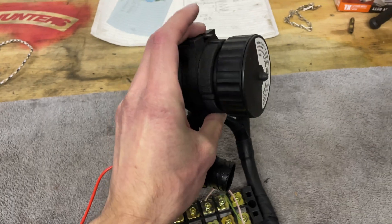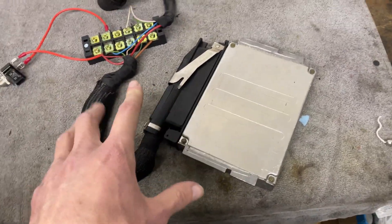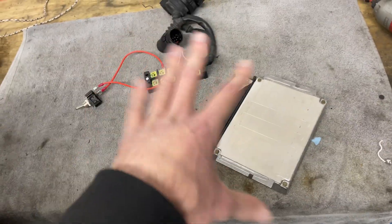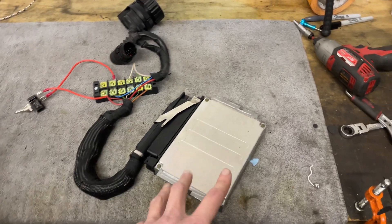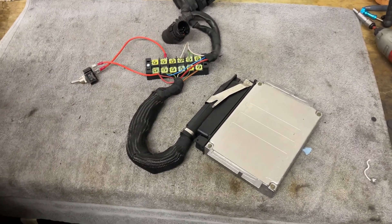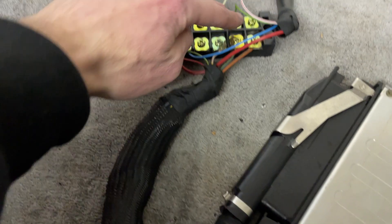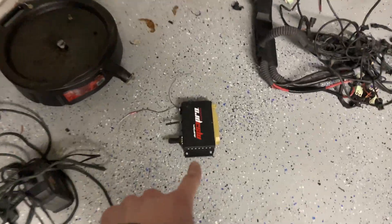I ended up wiring up a little loom so I can connect my laptop like I usually would on the car, with this switch simulating the ignition, and then the ECU itself. I should be able to bench flash cars now - people can send me ECUs and I can tune them without actually having a vehicle. I can do a whole bunch of troubleshooting and see if ECUs are bricked. I just need to provide power and ground and we should be in good shape. Pretty nice clean little setup.